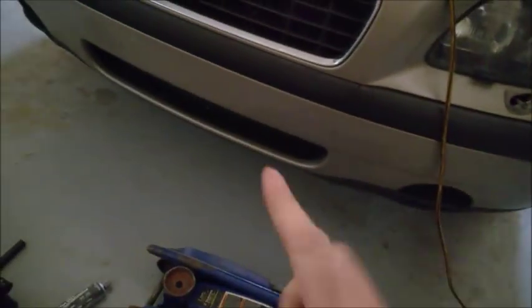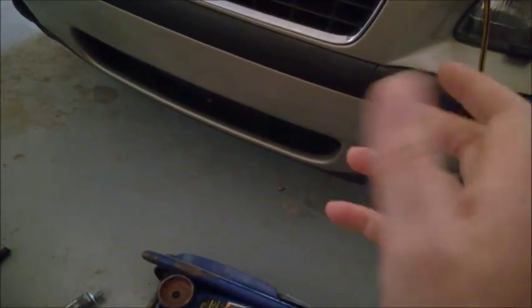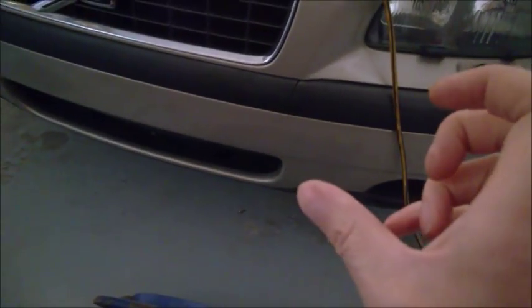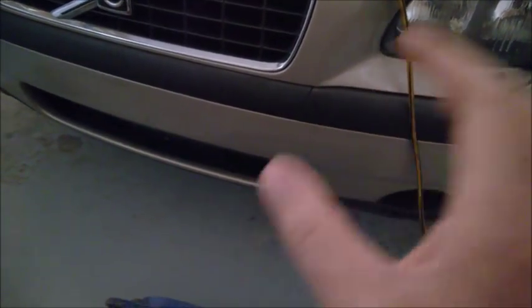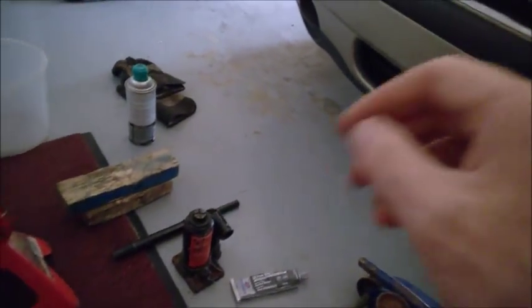The front bolts of the subframe, in theory, you need to replace them because they are stretch bolts. They need to be torqued and then turned. Instead, I will put them back, but check them. If they are rusted, you need to replace them. I will just put them back and not do the final turn. I will just secure them properly, and I'm not going to replace them.